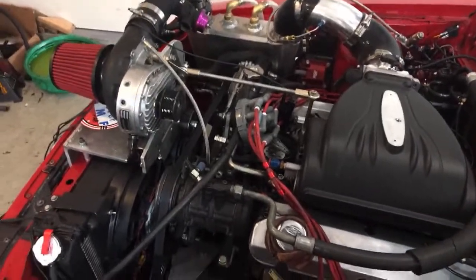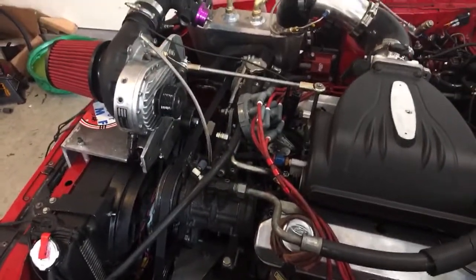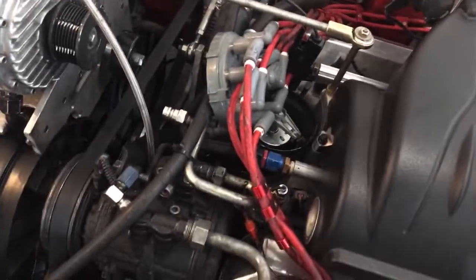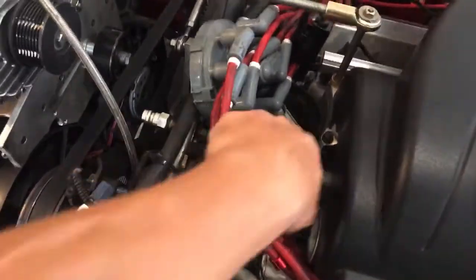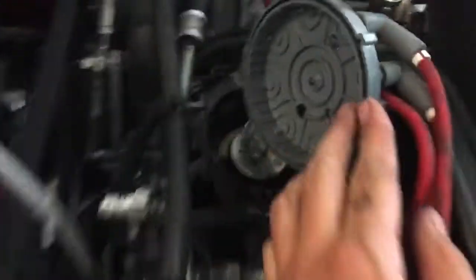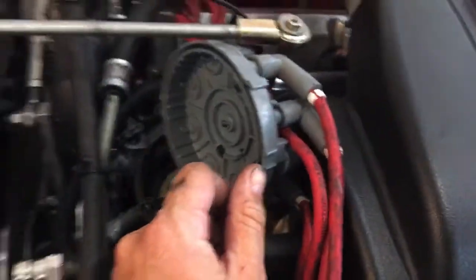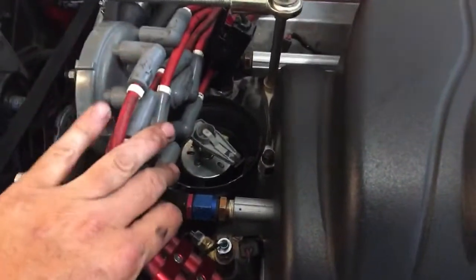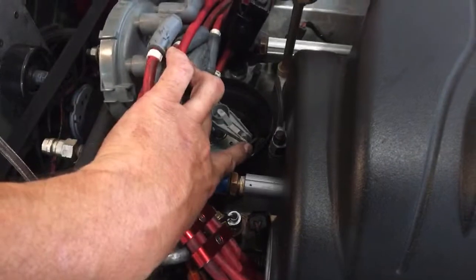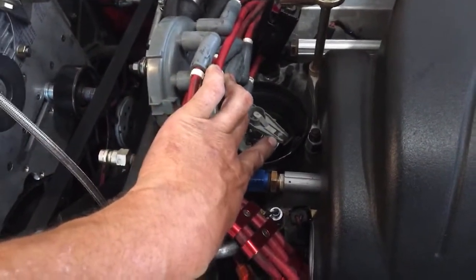What's going on YouTube, so today I am troubleshooting a few issues on my ignition and I wanted to show you guys something that I learned from somebody else. Rotor phasing is something that can be adjusted with an aftermarket ECU, and basically what that is is the relation of your rotor in relation to all of these pickups for each of your spark plugs. So if you have a distributor style ignition, checking your rotor phasing is important, especially if you've got an aftermarket ECU.